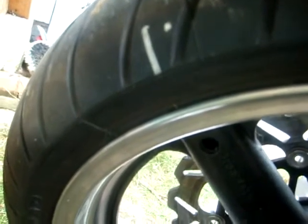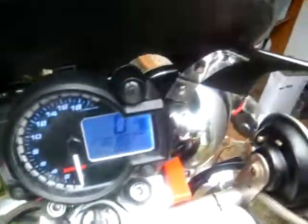But like I say, for the wheel, all I done was mark the tyre, sorry. If I come over here. Here we go. I've marked the tyre there. I put that at the bottom. I marked the concrete it was on, pushed it forward till it was at the bottom again, marked the concrete again, and just measured it in millimetres, and that comes to 18 whatever. And now the bloody clock's reset again.